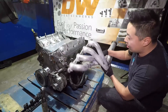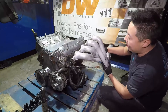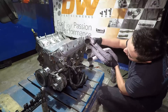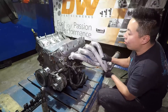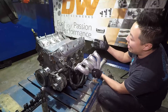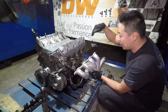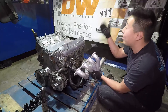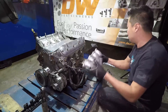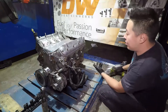This set of headers is made by Hooker — they're ceramic coated and they're the biggest runner they have, close to about two inches. It's a really good setup. My only complaint is that to put these in and out you really have to drop the motor out of the car, so it's not like the Daft Innovation kit where they can just slide in with the motor in the car. It's a lot of hassle to put these in. They're great manifolds, but if you're not pushing really serious horsepower, I'd probably recommend the Daft Innovation kit.